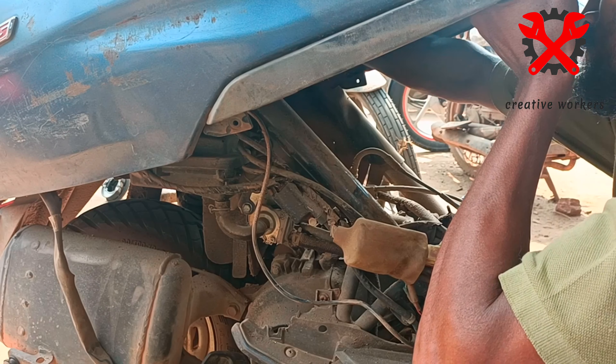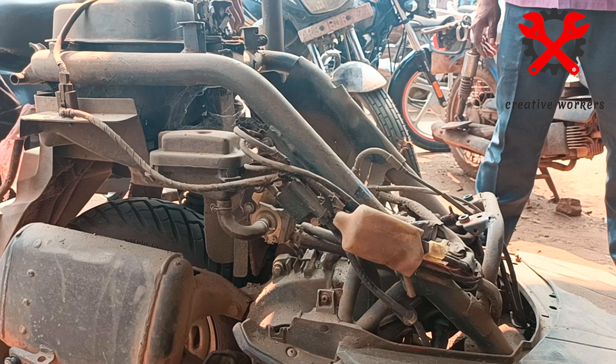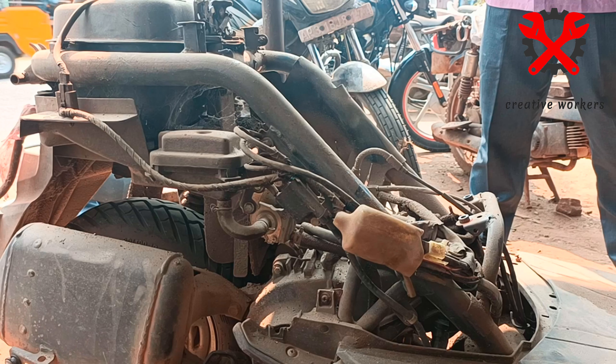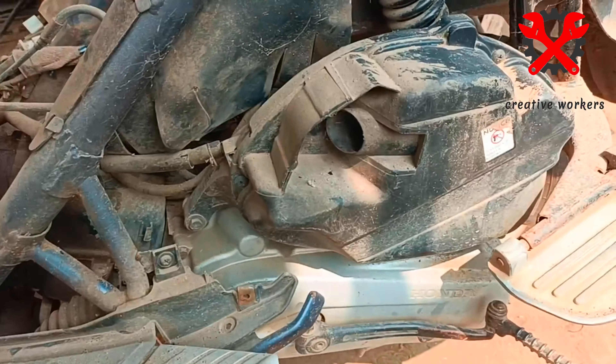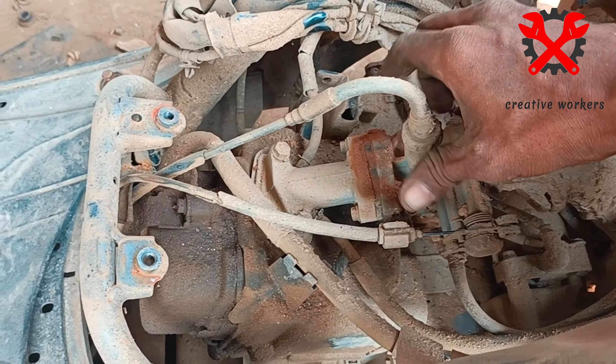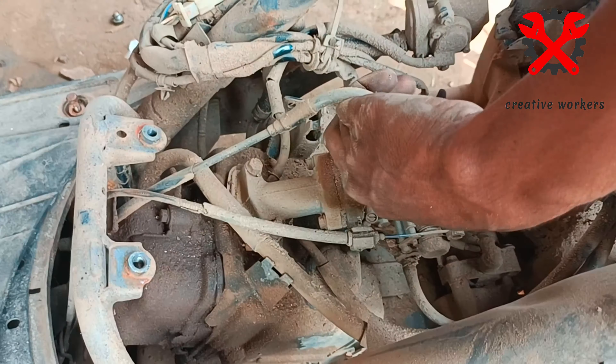You can use the lock and the seat lock. Open the lock. Next, you can separate the accelerator cable and choke cable. With that we separate the wires. We separate the accelerator cable and choke cable.